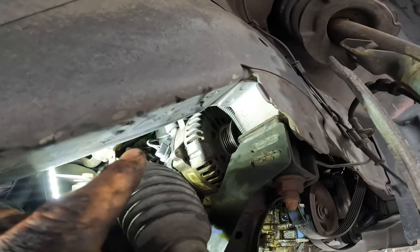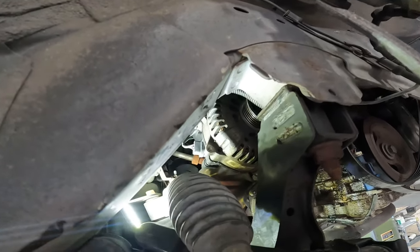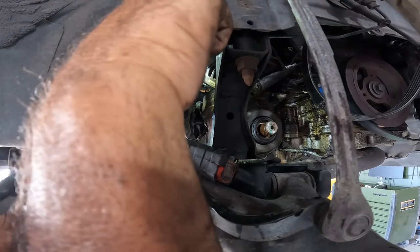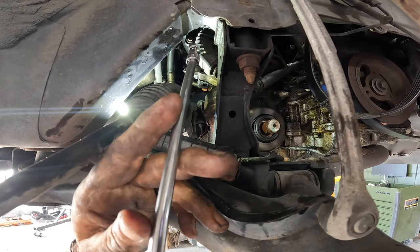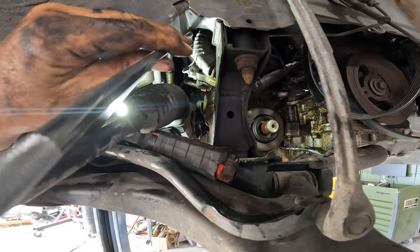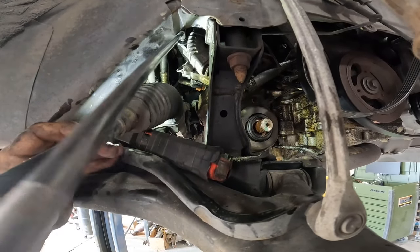That's your shield — you can get a better view now. The alternator is right here. We'll go ahead and get it up in the air and get that serpentine belt off. When you're taking the serpentine belt off there's a tool you can use — these things are all over Amazon, I've seen them as low as nine dollars. If you don't have one you probably should get one, especially if you like to do a lot of work at home. There's one bolt that holds an air duct on, one nut that holds the battery wire, and one connector you've got to take off. Just get up there with an 8 millimeter on a little ratchet and go to town.